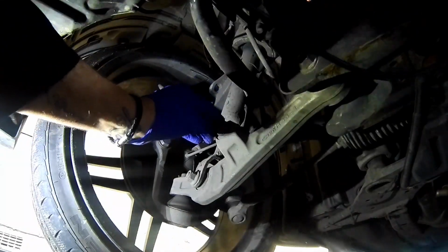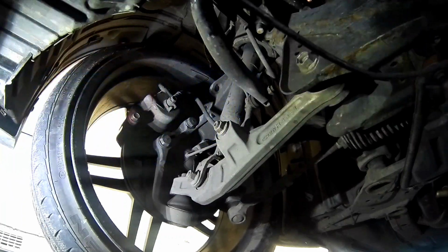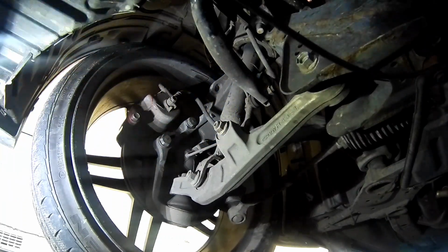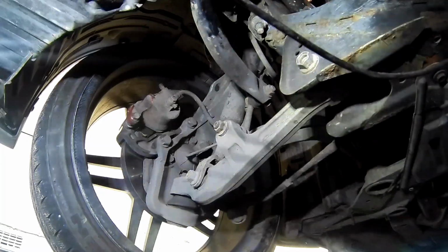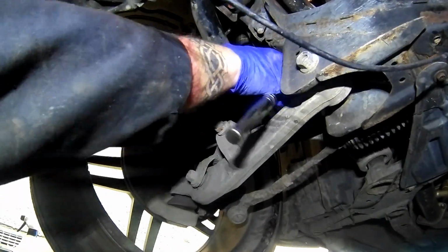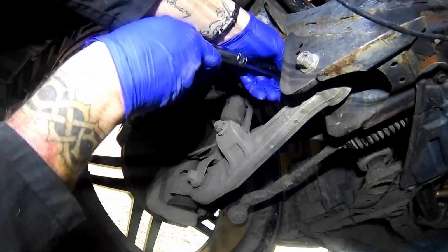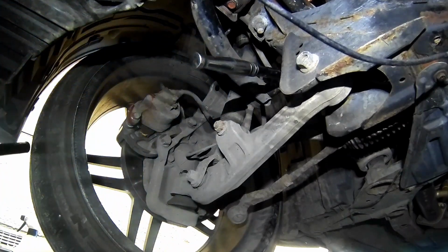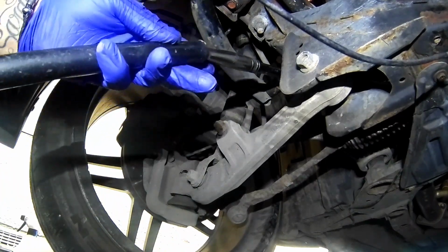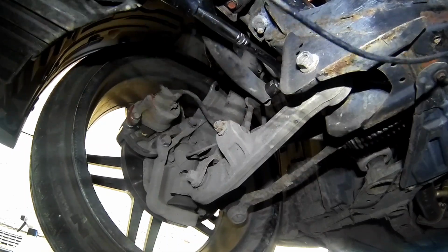This is the adjustable, or the drop link we're going to change. So it's two 17mm bolts. We're going to try undoing those and hopefully just removing the original, just using something over the end of the actual bar itself. So obviously we want to go down that way. So bar over the end, get down as far as we can, up as far as we can.